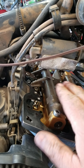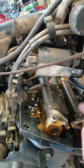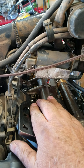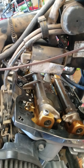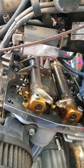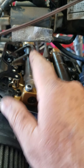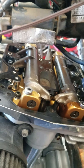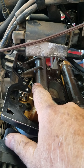There's a period where they're both shut. Right after the intake shuts, or when you know the exhaust is down, you can do the intake. This saves having to take everything off on the left side and turn the crank over to get it to top dead center with the bolt on the end of the crank. So you just bump it around. See the exhaust is open, so we can do the intake now.